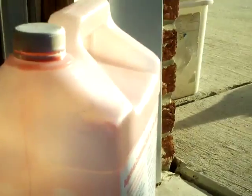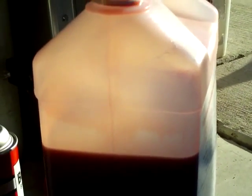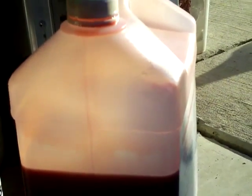Back to the transmission flush — that's how much we managed to get out of it. Probably about three and a half to four quarts came out of the cooler line. Out of my two-and-a-half gallon jug, that's how much I added back — with the top, probably three to three and a half quarts. I'm going to let it sit overnight and check the fluid level in the morning, and hopefully it won't leak anymore.